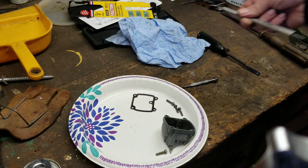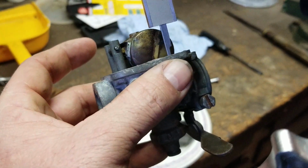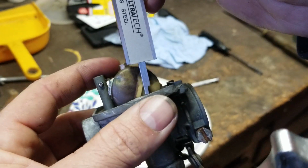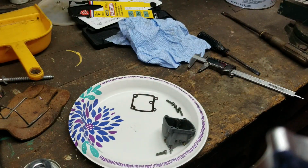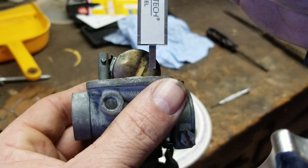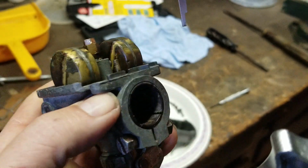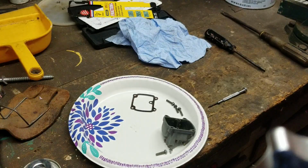Okay, and then recheck. Never put pressure downwards when you're bending the tab. Still off. Still way off. The float actually has to go down more. That means I've got to bend the tab. If the floats have to go down, you have to bend the tab up. Do that. Right there, look at that. Beautiful. Flip it over and match the angle. Beautiful.